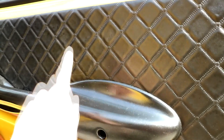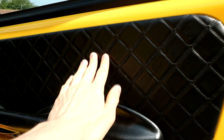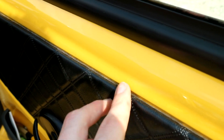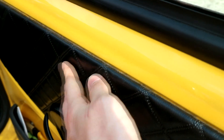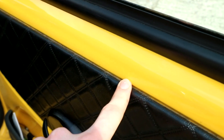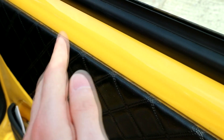The next thing to sort is the door cards. Oh, how good does that BMW black sapphire look in the sun? Looks gorgeous. The eagle-eyed amongst you will note these aren't standard — long-term viewers will know that about 18 months ago we re-trimmed these in this lovely black quilted leather stuff. The problem is they've never quite lived up to expectations — not in how they look, I still think they look incredible, but in how they fit. You might notice they don't actually fit in the door; they're sitting about an eighth of an inch proud of where the original door cards would have fitted in. The reason is very simple: underneath this material is some foam to pad it out, and the material over the top is considerably thicker than the horrible grey vinyl stuff that Fiat put on from the factory. As a result, the whole combination is thicker, but I'm using the same size clips so it can't seat in as deeply.